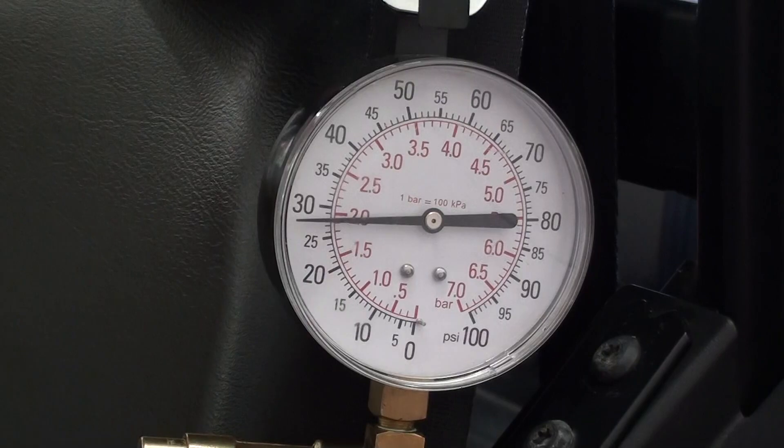One other thing I want to show you is this sample of fuel that I ran through that gauge. That fuel looks really dirty — it's got some real fine particulate matter in it, kind of turning it brown almost. This type of matter will go through the fuel filter; the fuel filter won't collect stuff that's that fine, it'll work its way through. Generally it won't cause your pump to fail outright, but it'll just prematurely wear it to where the pump is bypassing and can't create proper pressure. This old dirty fuel is what gets them every time.